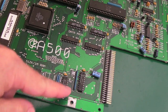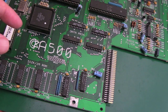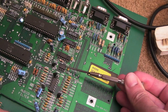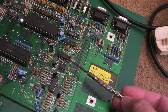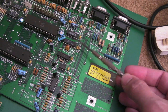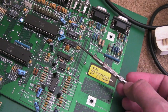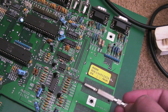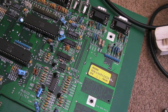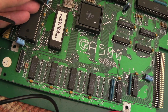We've covered most things. There are some smaller chips here used for memory management related to the expansion stuff, and then a few smaller ICs - somewhere there's a 555 timer for the reset circuit. Then you've just got a few jellybean 74-series logic chips, some of which are used on connections to Gary and some CIA stuff - just the odd signal gets ANDed or ORed. These things typically hardly ever fail, but you can get problems like a dead 555 keeping the system in reset.